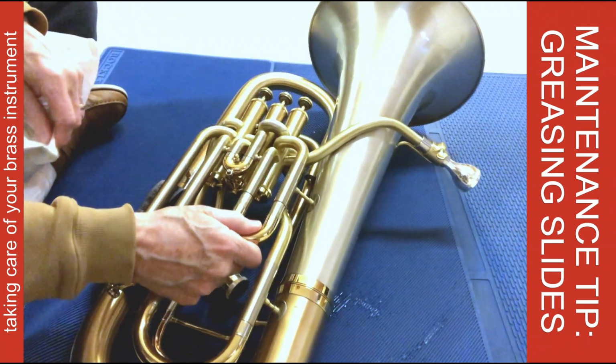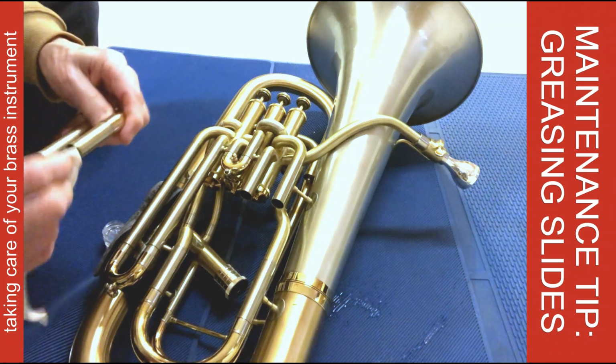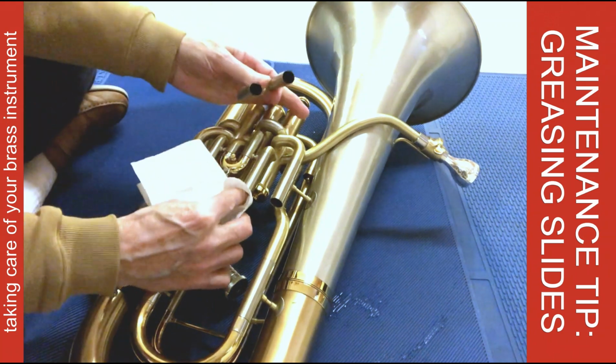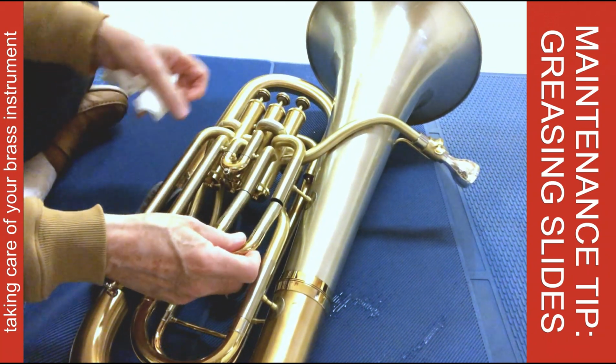In case you have used a lot of grease, I would do one more go around of taking the slide out, cleaning the inner tubes, cleaning the end of the outer tubes, and putting it back together.